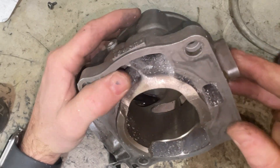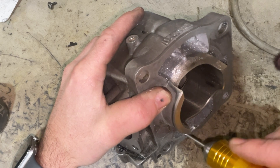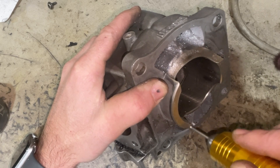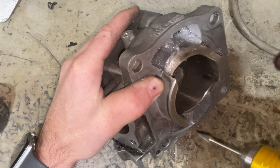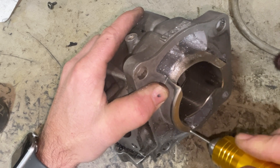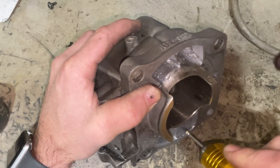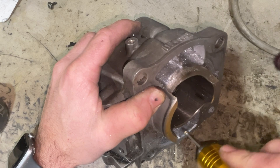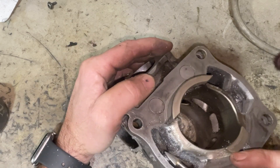I'm just going to skim everything a little bit — the 2001 is supposed to have pretty good lower transfer matching. I'm just barely opening it up so the volume coming up isn't restricted. I may go back at that again once this cylinder goes on and I lay a gasket down to see where we end up — that's what I did with my last one.